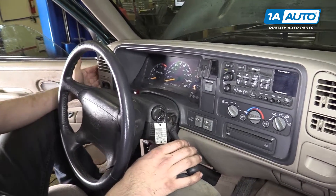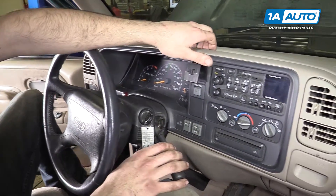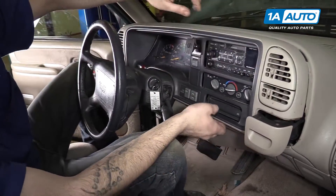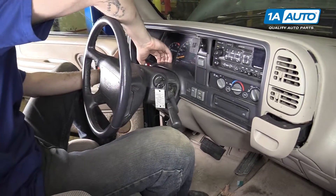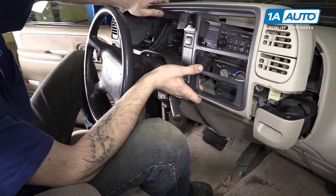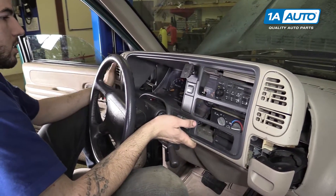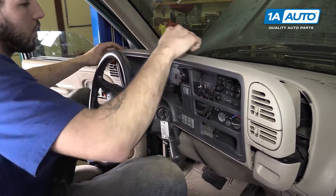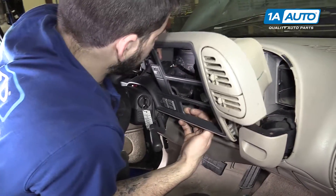You can then simply put your fingers behind the dash panel and carefully go around. Open the cup holder a little to get that clip out, and pop all the clips out. You've got to kind of scoot it forward and then pop that rear panel over the instrument cluster up so you can move it around a little.